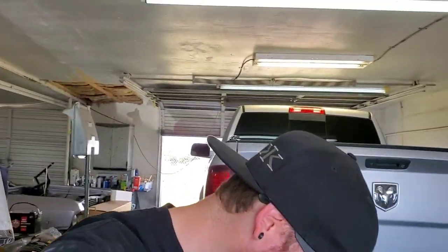It's hot today - it's not even summertime and we're in here with not a lot of airflow. We went ahead and finished another 2000 grit quick wipe down, then DA 3000, then a hand wipe 3000. Now he's doing the first session of compound. For a fiberglass hood this thing looks slick, and this is just the first session.